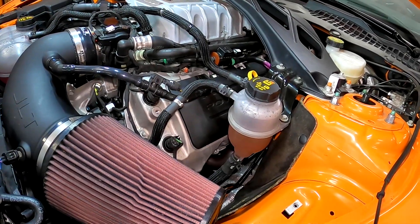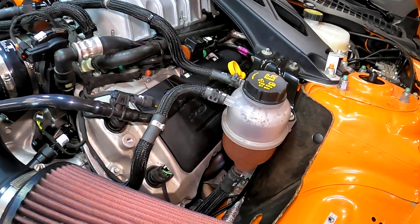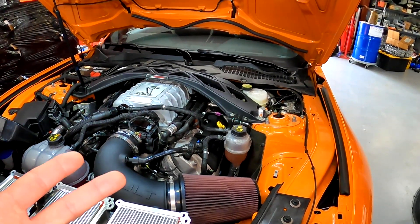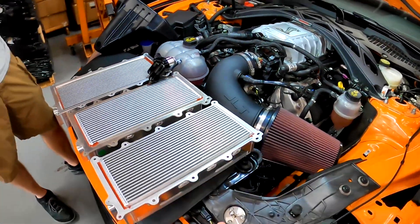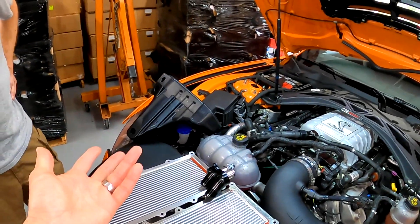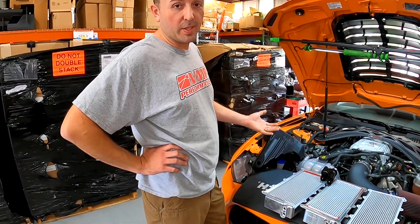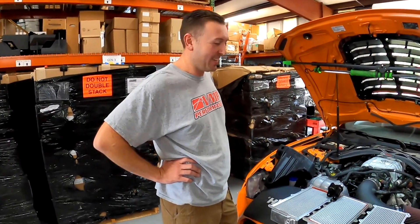On the 2020 GT500 there is currently no reservoir whatsoever on this car — there is just a fill point. This is basically where you can just top off your intercooler coolant fluid. The fluid is just what is in the core and in the heat exchanger — there's no larger tank, and that's bad for having less coolant to work with. This will give you the ability to add ice for drag racing, which — listen, this car is never meant for drag racing, but people do it anyway.